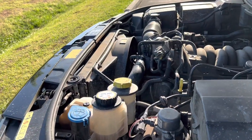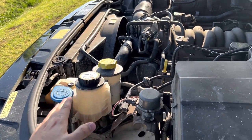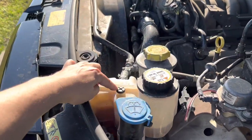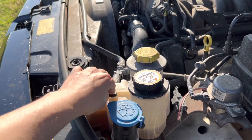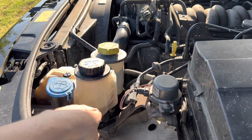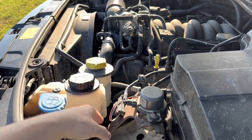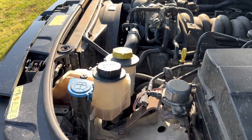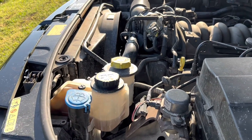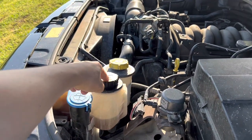Here's what I did to stop the overheating: I let the system cool down, waited about nine minutes, then opened the pressure relief valve and let remaining air out of the system. Then I closed it, opened the radiator cap, and the fluid started going down. I had a water bottle ready and started adding water directly — it kept sucking the water in. That took about three-quarters of a gallon, and altogether I used a gallon and three-quarters.